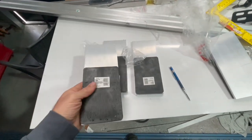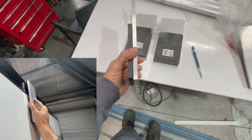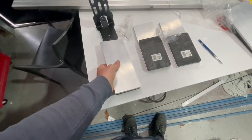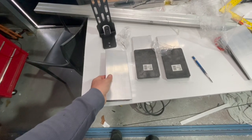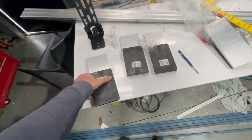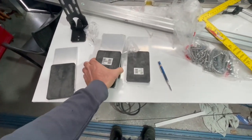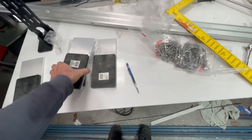These are the awning brackets that I've made up. It's just a bit of 10mm aluminium, 100mm wide, which was made to suit these plastic packers — they're literally just adding width to my setup. They're a 100mm packer with 10mm thickness. It's a bit of a delicate dance because it needs to be strong enough to hold the awning up in normal use — vibration driving along the road, when it's set up and pegged down. But I don't want it to be so strong that if I ever catch a big gust of wind and the awning lifts up, it rips the side of the van apart. So the bolts are only 6mm or 8mm shank and there's 3 brackets. Hopefully if there's a gust of wind, the brackets will bend or snap, or bolts will snap, before the side of the van rips apart.